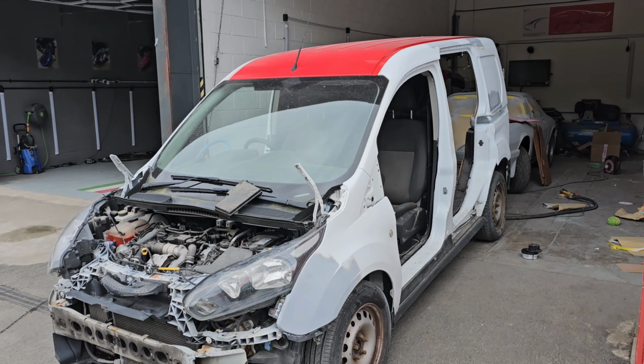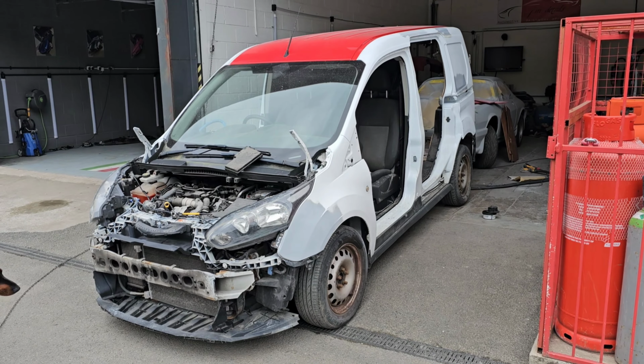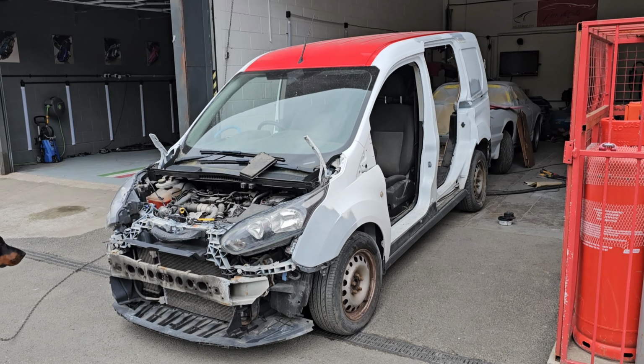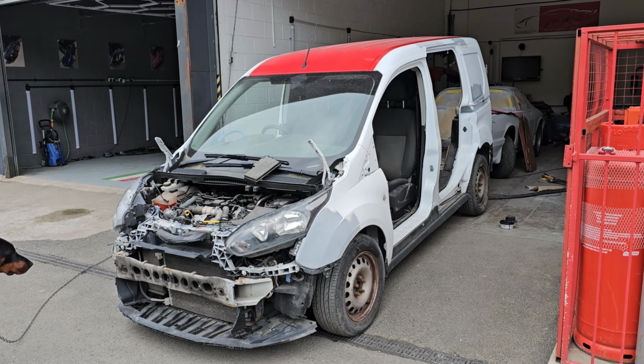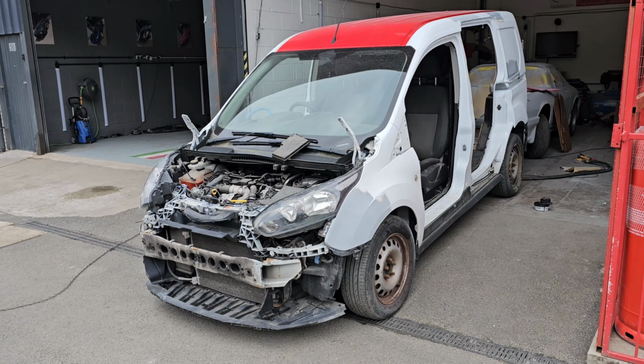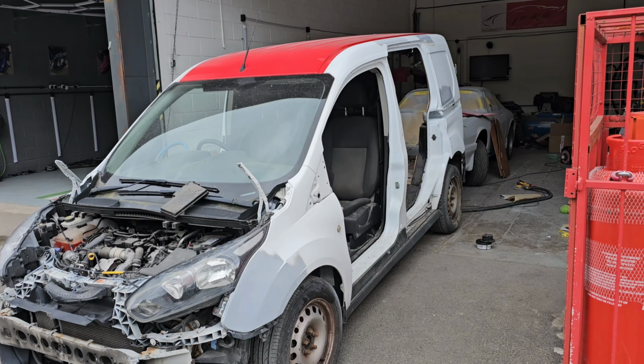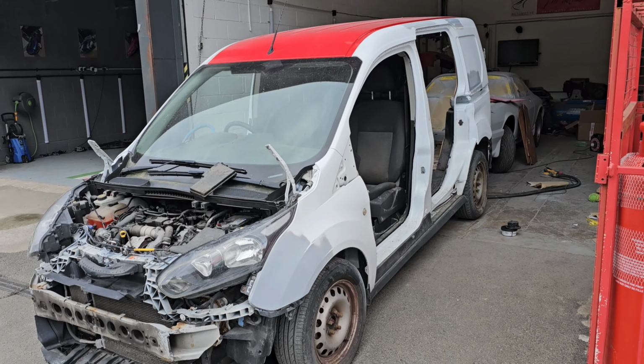You can sometimes get away with polishing it, but I've gone with quite a coarse flake on this one, not nearly as coarse as you can, but it should be a fairly decent effect. But like I said, basically we need to flat the clear down afterwards, and then flow coat it with another coat of clear over the top. So it's just the way to do it this way around. Black first, mask it off, paint the red, flow coat over the whole lot then.